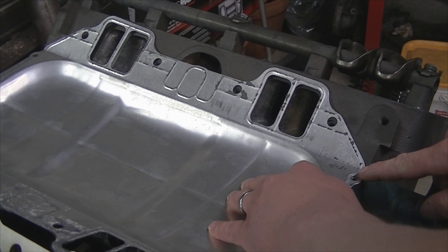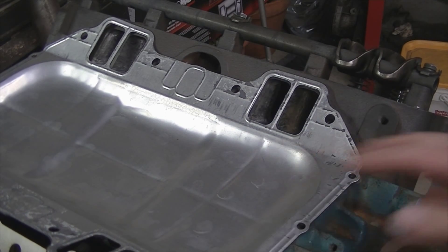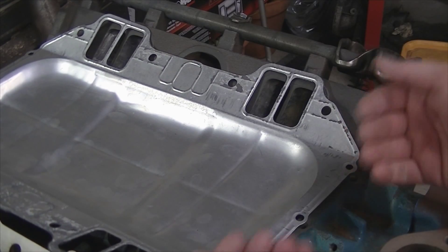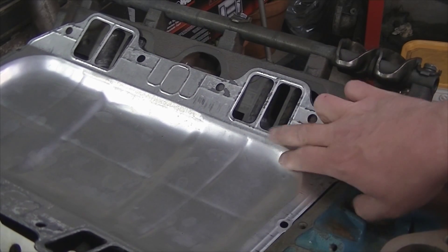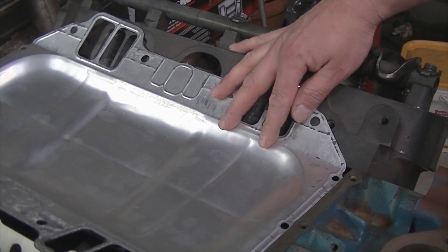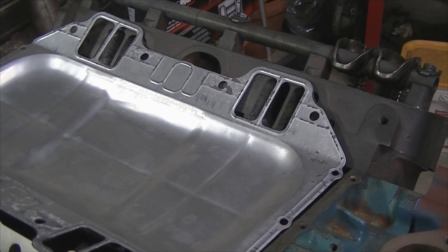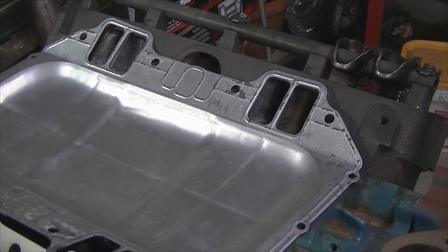Also the bolt holes are completely off. I've done some research online — there's really no good way to effectively use this pan gasket. My personal thought would be to machine this gasket surface down here, which would drop that down to the level of the cylinder heads and the intake ports, but I think I would have to move a considerable amount of material and that's just not a plausible situation.